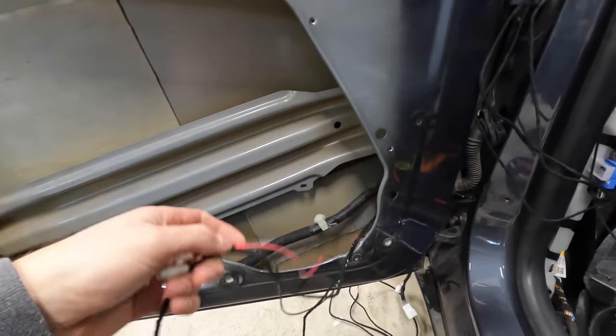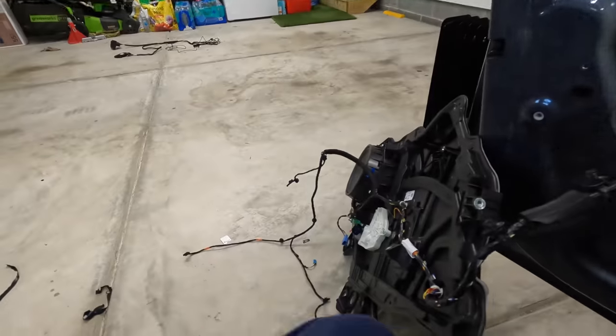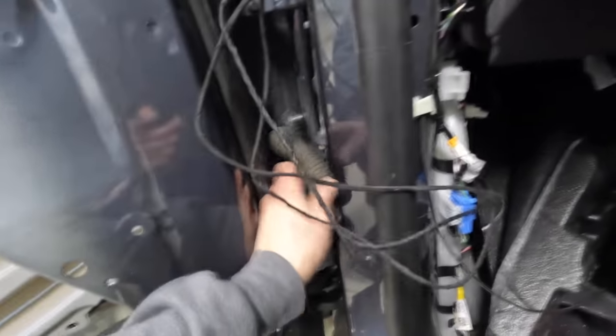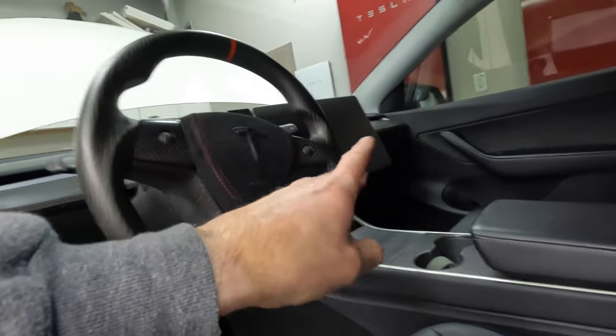Run wires through the firewall grommets to the battery — not very difficult on the passenger side, just takes time. I got four wires in, running two at a time through the grommet. Use spray wax to help them slide. Be careful of the thin wires at the bottom — the wire fish can snag them. Once wires are inside the door, pop the panel off and feed everything across to reach the autopilot computer and through the firewall.